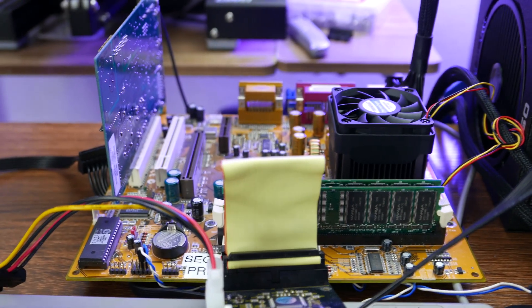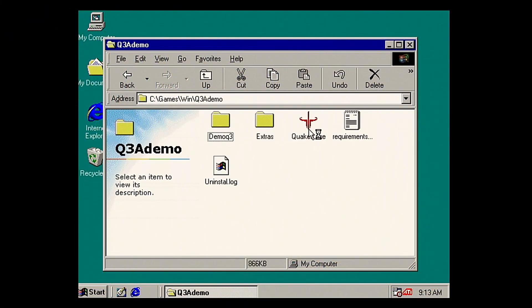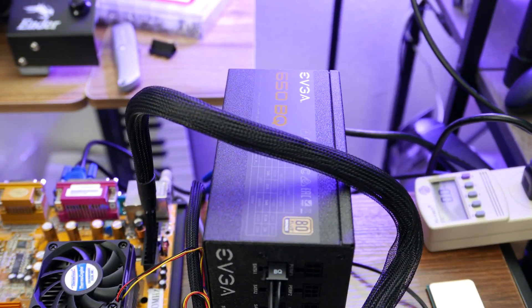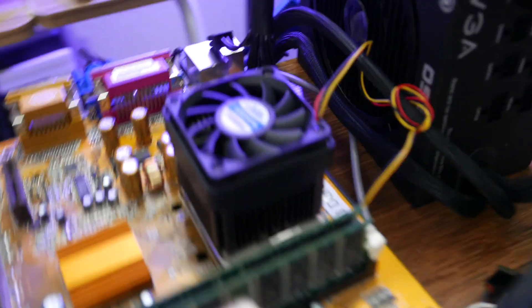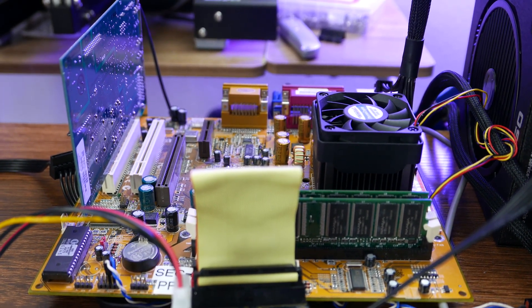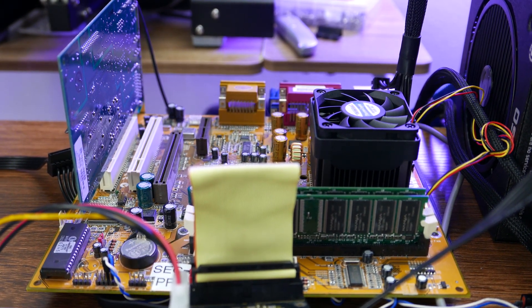The downside is the cards that don't work in this board seem to be pretty much anything that's AGP 8X. As soon as you install the drivers and it tries to switch over to the fast AGP GART, it doesn't work — black screen or system freeze, it just won't do it. I moved up to a beefy power supply to see if it was a power issue, because this is an early board so everything's going through a 20-pin ATX connector. That wasn't it. Even low-power AGP 8X cards like my GeForce FX 5200 would not work. Same with my GeForce 4 MX 440 AGP 8X — wouldn't work.